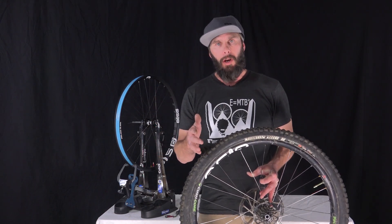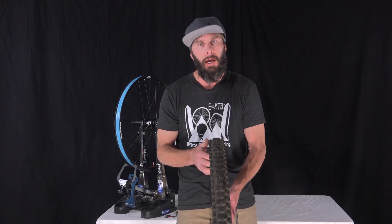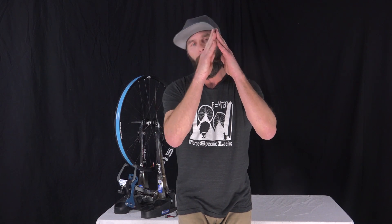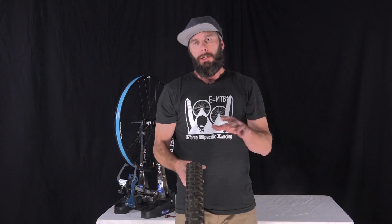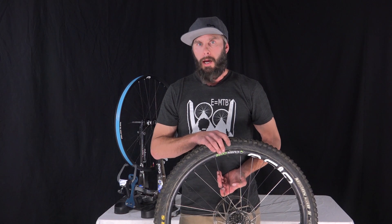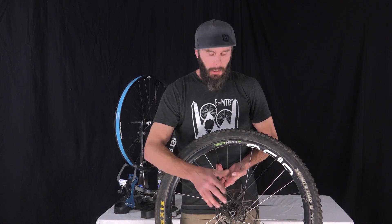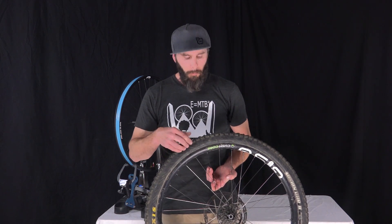If you're not familiar with what's going on with bicycle wheels — these wheels we ride are all dished, meaning the spokes aren't coming off the hub at equal angles. One side is scooted in to make room for the cassette on the rear wheel, and the other side to make room for the disc on the front wheel, which makes the wheel want to center itself when you twist the hub dramatically. The traditional bicycle wheel was slowed down by a rim brake; the wheel was never being twisted. Now that the rotor is attached to the hub, the spokes take all the braking force — 32 spokes in the wheel, 16 of them take the braking force.